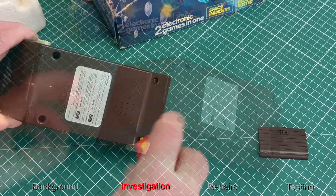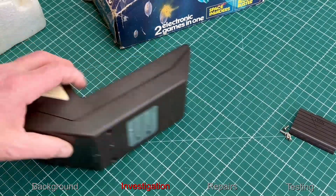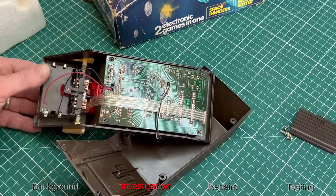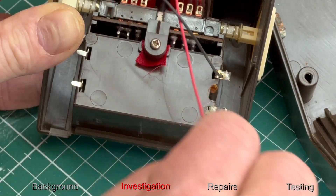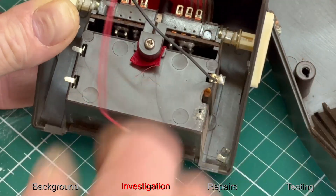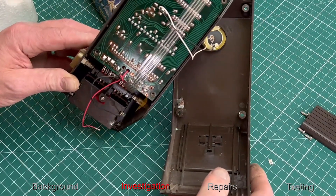Time to release the four screws to separate the two parts of the casing. That's our first view of the electronics inside. Zooming in, we can see that the positive battery connection cable is off and the terminal itself was completely corroded through. Above the battery compartment there's a combination of three switches — two side movement switches and the center fire switch. On the right-hand side of the casing is the speaker, and on the left-hand side we have the circuit boards.